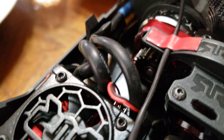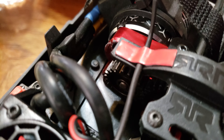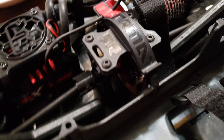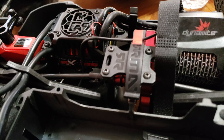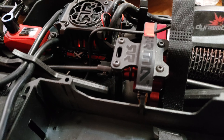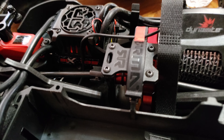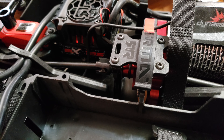On the motor I got a 21-tooth. I did have to Dremel out the motor mounts in order for them to fit. I'm not going crazy right now because if I go any higher on the motor mount, I know I'm definitely gonna have shutoff issues with the ESC.